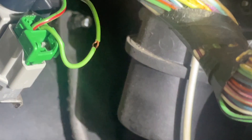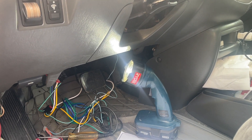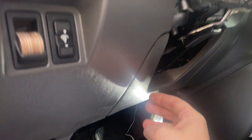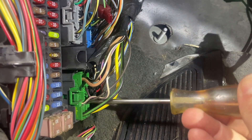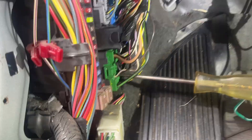These inline connections - I don't love doing them this way, but I can tape it back. You can't use heat shrink, but you can at least tape it. So those are my parking lights - on, off. That's obviously the connector going down to that same area. By just probing a bunch of these, I figured out that this brown wire is my parking light. Parking lights on, off, on, off. That's that one.